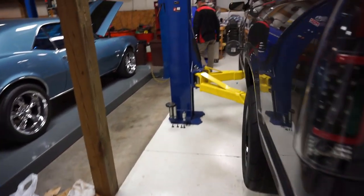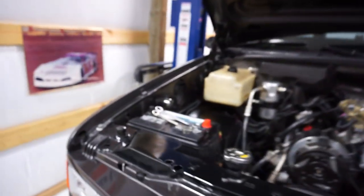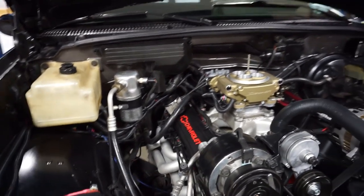The only thing left to do in the kit is we have to take out that blue wire, which you can see here. That's what normally would drive your external pump. And for this particular truck, we're not going to use that because we're using a stock pump, well, not stock pump, but the stock-ish style pump that took the place of the old one.